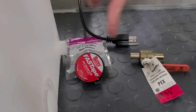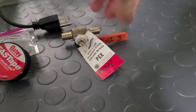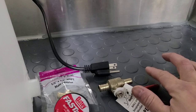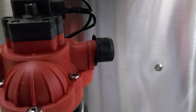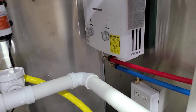We're using PEX to connect all the plumbing. Make sure you use some sealing tape, then we're going to come out with a little piece of PEX and connect to a PEX ball valve made by SharkBite. This one's not required but it's a safety thing — you can always shut your water off. It's about seven dollars. Then we elbow up and go into our water pump made by Sea Flow. The top has arrows showing water flow direction — water comes in from the tank on the right side and comes out to feed the water heater.